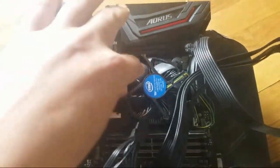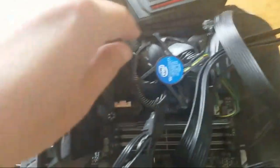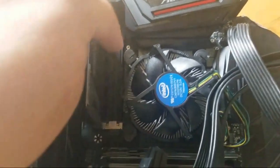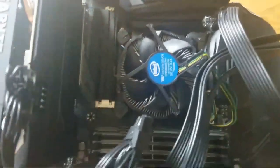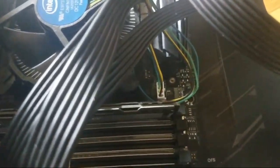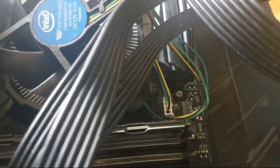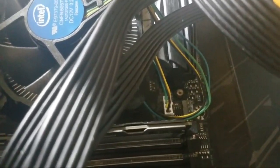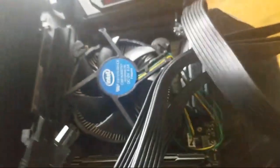You're done. Usually they come with a fan. You put the fan in. There's 4 holes on your motherboard. 1, 2, 3, 4. You get it into the holes. You press down. These little plastic knobs go into the motherboard. And they're underneath here now. And you're ready to go. Then there's this little hookup. This is the fan. And it should say right on the motherboard, fan. You plug that little cord right into the fan module there, and your fan's ready to go.